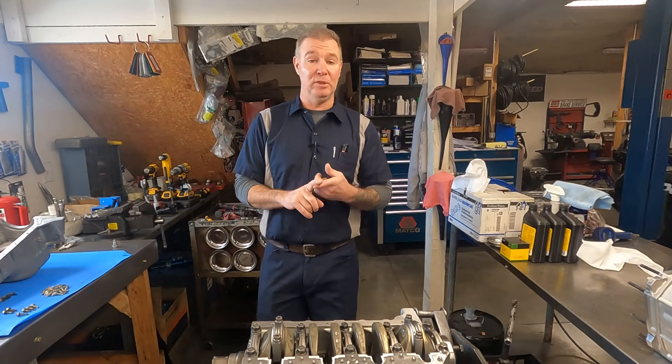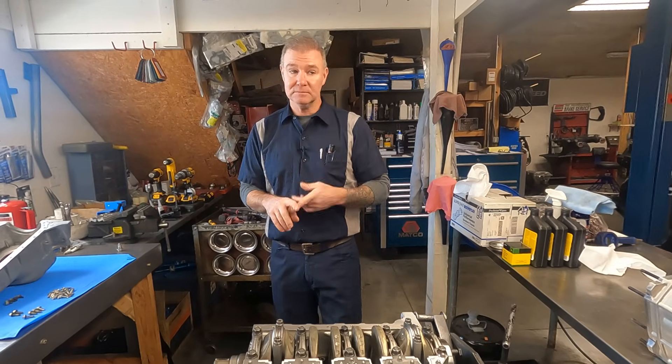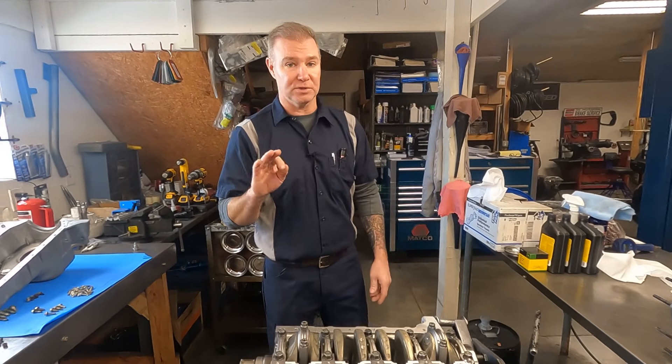In the race cars, the other thing I do are crank scrapers. You can see this crank scraper bolts into the mains. As the crankshaft comes around, you have to actually trim the Teflon here and get it as close to the crankshaft as possible. The Teflon will actually wear just a little bit if it's touching — that's going to scrape all of the oil off of these throws. We need to clearance the connecting rods as well. I use a tiny little razor knife and take my time trimming these up. This helps keep oil from spraying up into the top side of the block and keeps it down in the pan. The baffle plate gives the oil time to de-aerate and get to the bottom of the sump. This is how we control a wet sump Miata bottom end — works like a dream, and couple that with an Accusump and there are no oil pressure issues whatsoever.